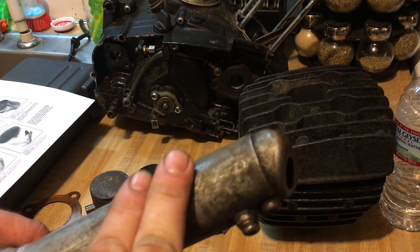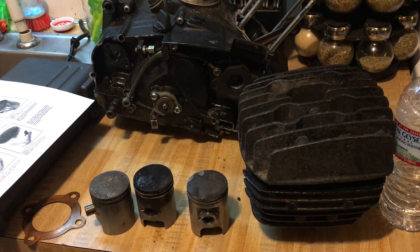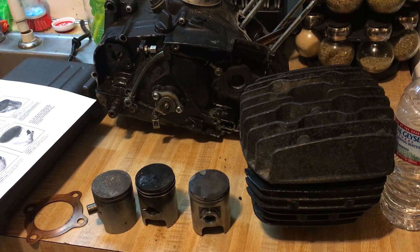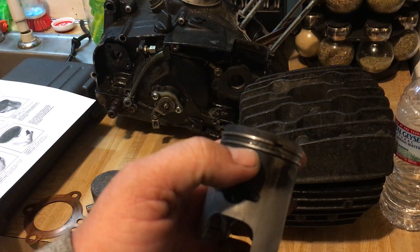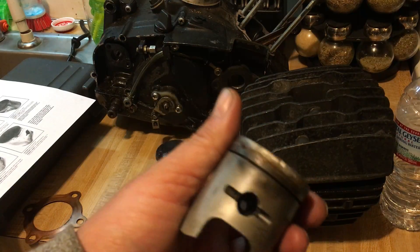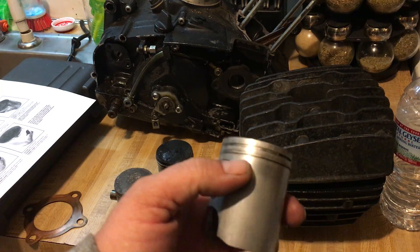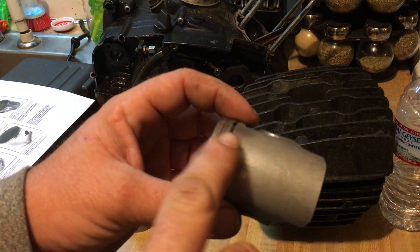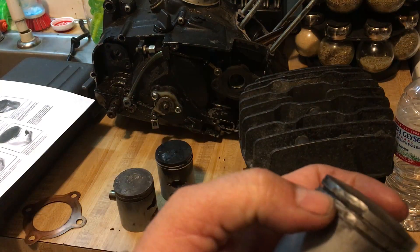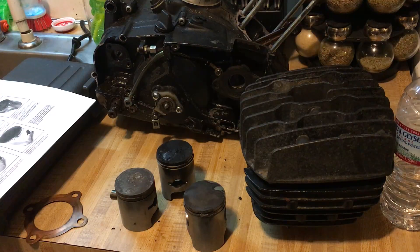I'm going to show you guys how to clean the exhaust tip and you'll see how bad it gets. That's all I have for tonight. Thank you guys for watching — by all means leave questions, tips, and tricks in the comments. To recap: heat range, low ash oil, don't run too lean, no foreign objects in your engine. Running the engine too lean and too hard for too long will also cause that damage — and if it's really lean you'll see a lot more scoring. That's a really bad situation right there. Please subscribe!